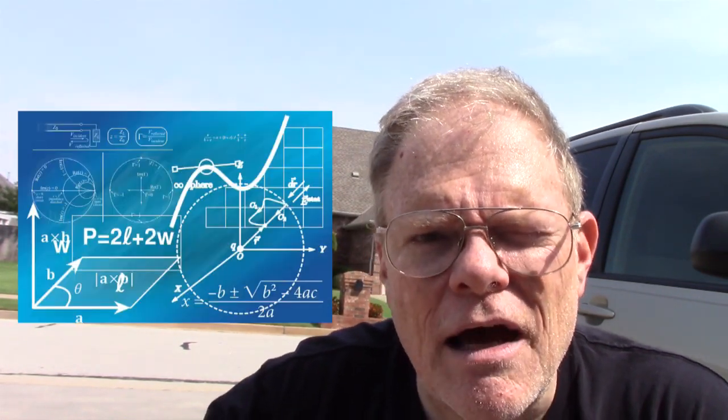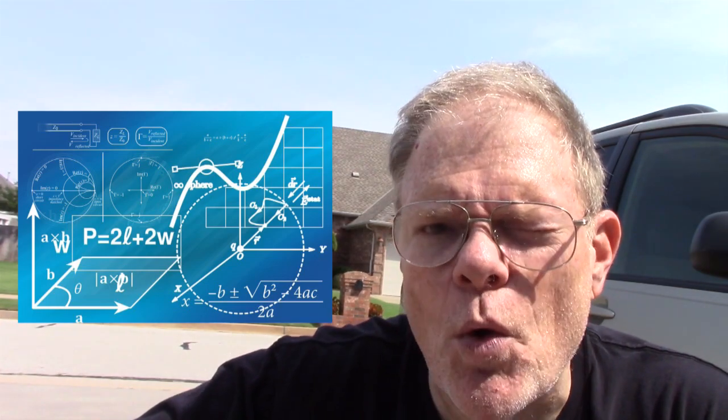And what we can do is by doing this over a period of repeated cycles. If I replace about 1/3, leaving 2/3 behind, I can then wait about 250 to 300 miles after that first change and repeat the process. I'll take that 2/3 that I left behind and only leave 1/3 of it behind by replacing it again. That second time I have now left only 4/9. You do a little bit of math. I've only left about 4/9 of that original fluid behind, meaning I am now about 55% replaced.